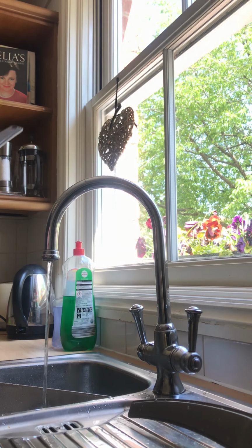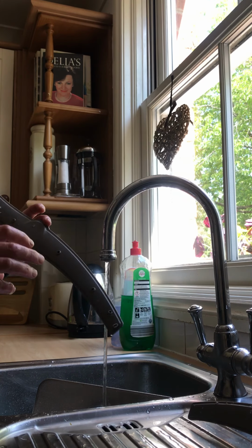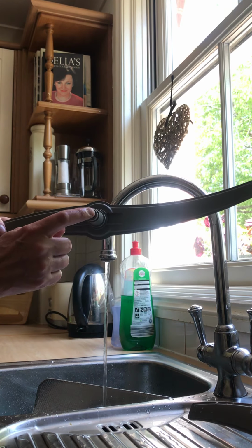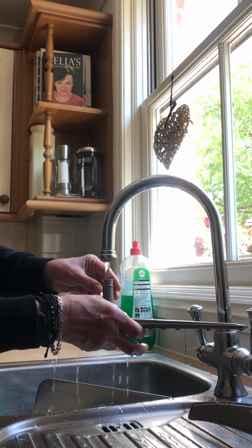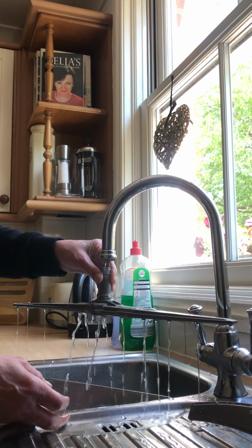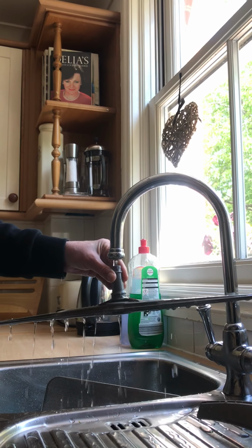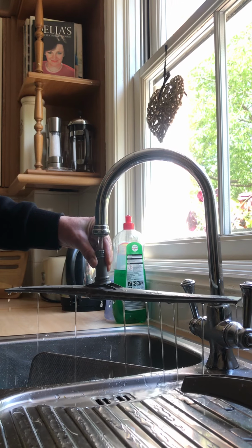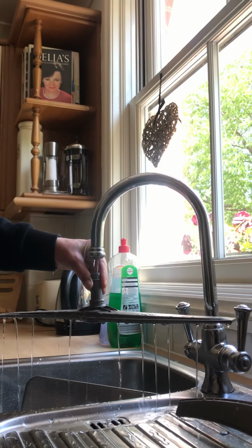This one is the bottom sprinkler. And we're going to do the same again. Just basically, where the water goes in the dishwasher, simply run water through it like that, and you'll be able to see one moment the water coming through the sprinkler hose, which means they are clear. Great.